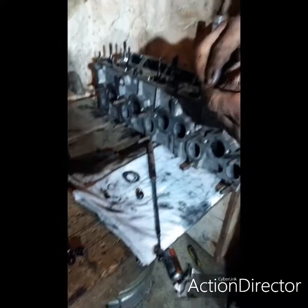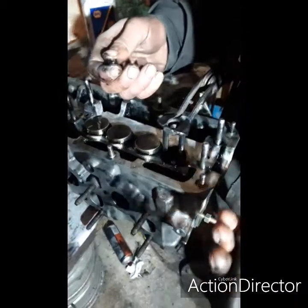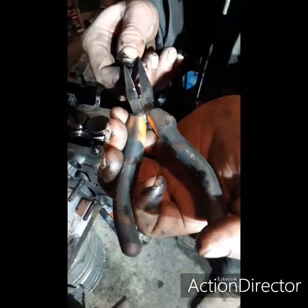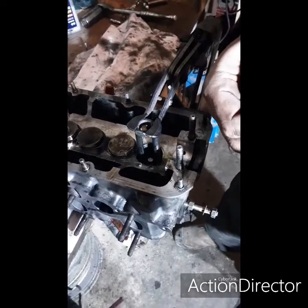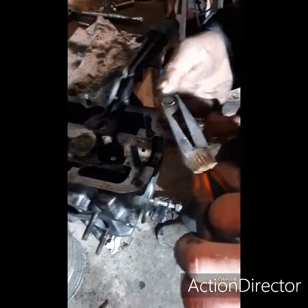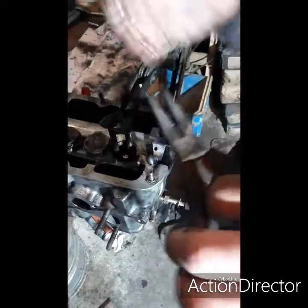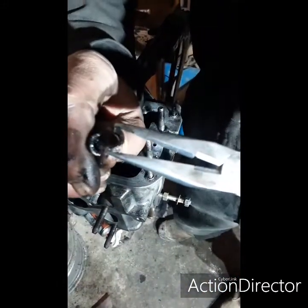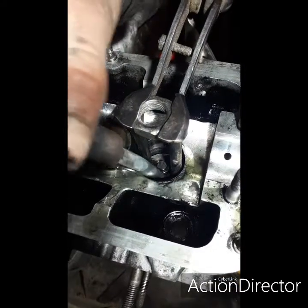So next thing is, it is very awkward, and I have tried it with a magnet but you can't really get in, so I found the best thing is pliers again, but they're very hard to grip, so you've got to try and just get the corner of them, and then they have to go with the taper going down to the bottom, because when the spring comes back up it clamps them both together round the top of a valve. That's one on.